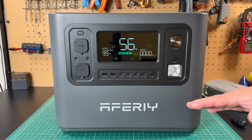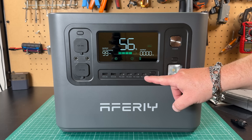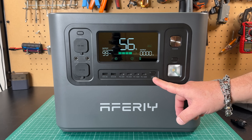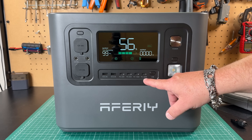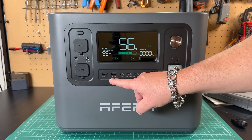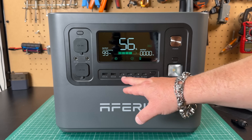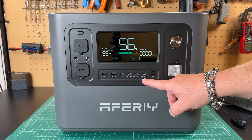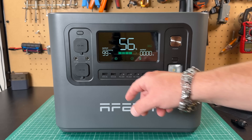One of the things I really loved about the older version, the AFP210, is that we have four USB-C PD outlets and two USB-As. On this model, the AFP280, they have upgraded these two PDs to 140 watts from 100 watts on the previous one. It does look like they went down on these though — these used to be QC 3.0 and now they're just 5 volt, 2.4 amps, which is kind of outdated. These could all just be USB-C PD, but I really like that they improved these two PD outlets to 140 watts. These others are 20 watts, and then the USB-As are 5 volts, 2.4 amps.